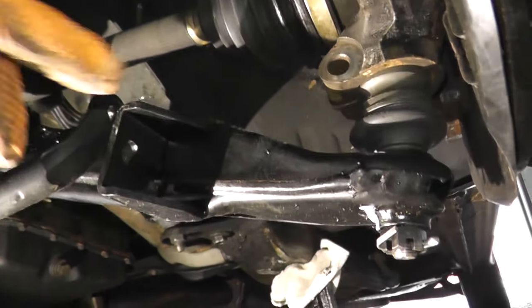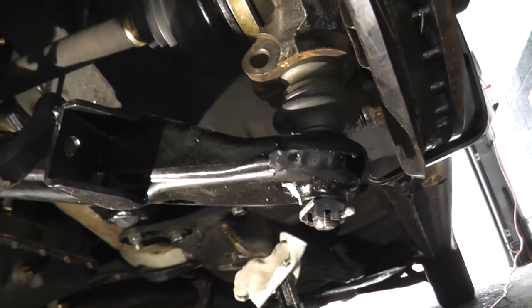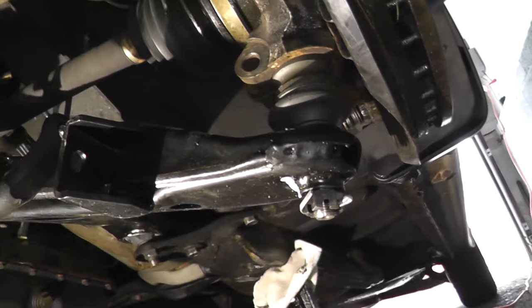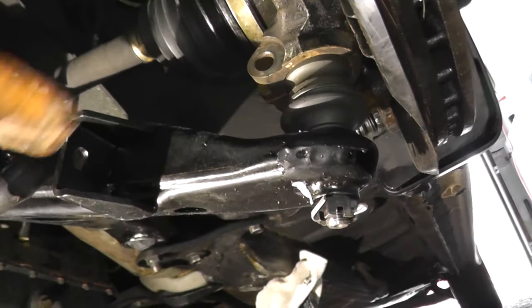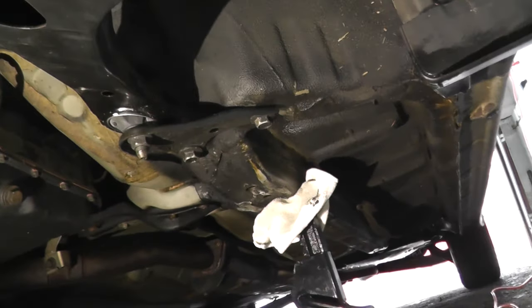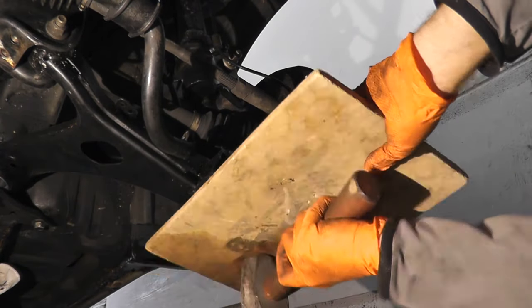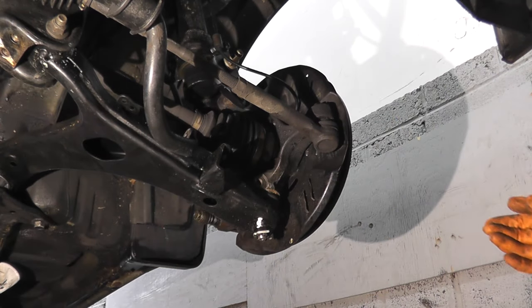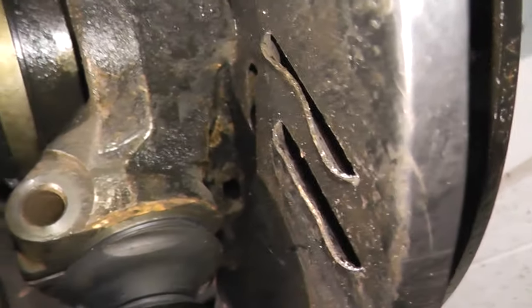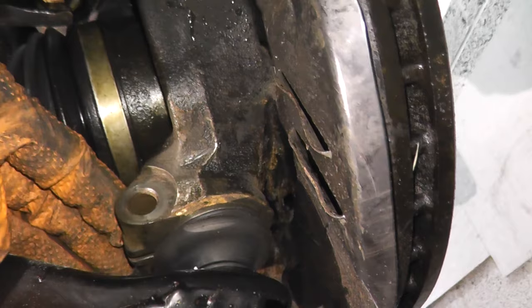Quick recap before wrapping up installation: the ball joint is ready to be installed in the knuckle. Use a piece of wood on the bottom and slowly tap it in with a heavy hammer. Alternatively, you can use a floor jack to slowly jack it into the knuckle — whatever works for you. Sometimes you have to wait for the spring to compress, but typically a heavy hammer is fine. Look around 360 degrees and check the backside — this looks seated already. Then reinstall the pinch bolt.